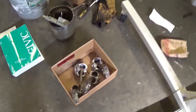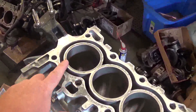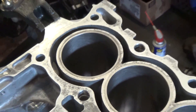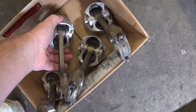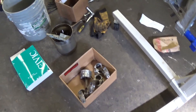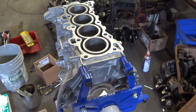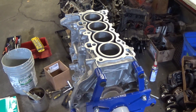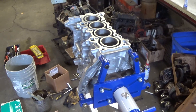On the piston rings, I believe it's 75 millimeters. Unless they hone it to scuff it up — you can see some scuff marks on there — for me it was very inexpensive to have them do it. I didn't go oversize, so I'm going to order standard-sized rings and reuse my pistons and rods. You'd only change that if you told the machine shop you wanted a bigger bore, which would change your compression and require a whole bunch of different calculations. This is my first build, so I'm keeping everything OEM stock to avoid worrying about whether I calculated compression correctly.